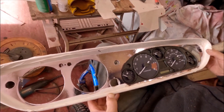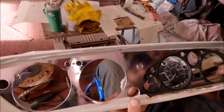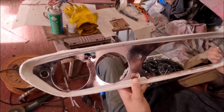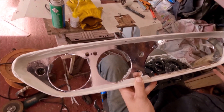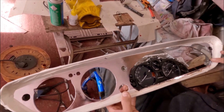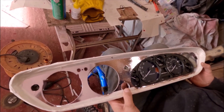This is just a quick mock-up — we've edged out the original dash around and infilled a little bit of the cutout material into this corner. The next step is to finish it off, get a nice even radius, smooth it out, then we'll bond the gauge surround itself onto the back. We're going to order a piece of perspex, two mil, potentially three, bonded in flush onto the backing surround. An alloy dashboard cover goes in the middle — whether we engine-turn it, brush it, or something else isn't decided yet. The perspex infill panel means there'll be a continuous surround with no gaps or light bleeding through, so it should look hopefully fairly factory.